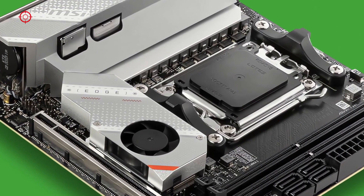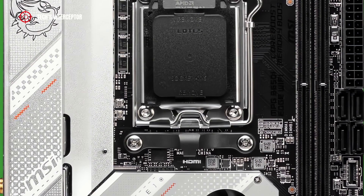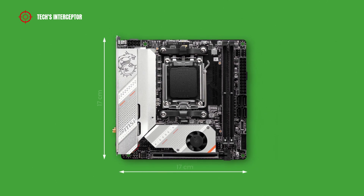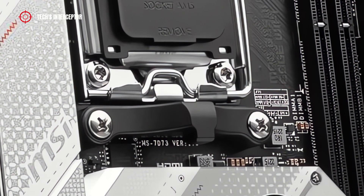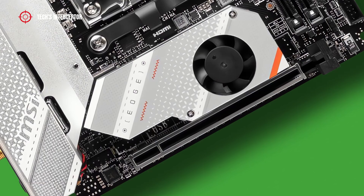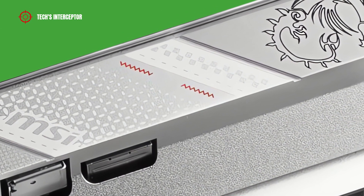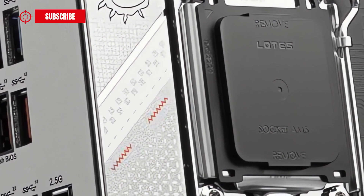The new MSI creature is not big at all — on the contrary, it is very small. In fact, it has a mini-ITX form factor with a size of 17cm x 17cm. Its compact layout is based on a 10-layer PCB with 2oz thick copper. On this board rises two fundamental elements to keep it perfectly cool. The first is the massive, fully-covered MOSFET heatsink with a thermal pad on the side of the CPU socket, which also covers the I/O back panel.